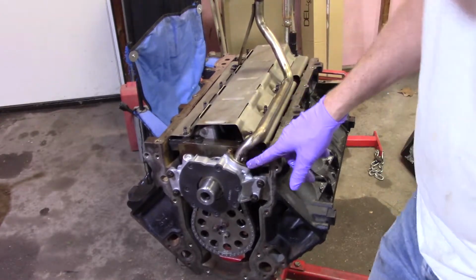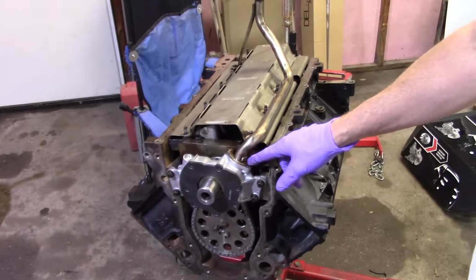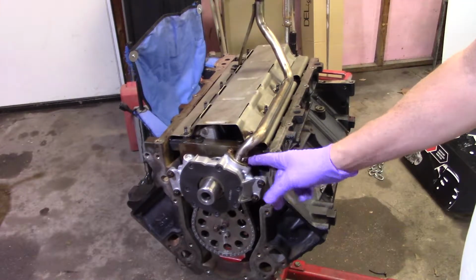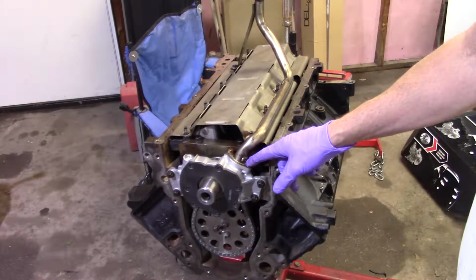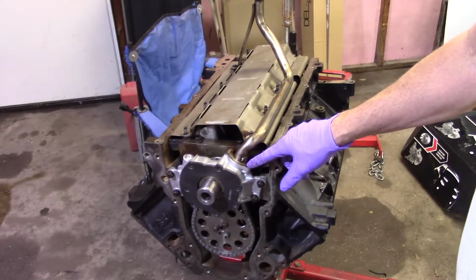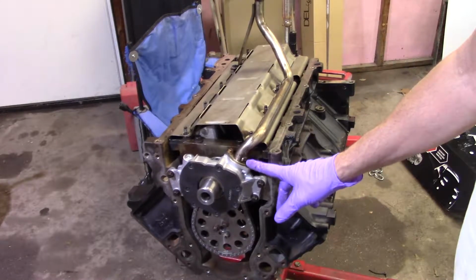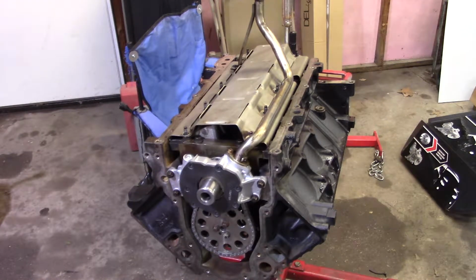So, okay, they do make a kit that will replace it, for if you cut it off, or if it's a whole different deal. And I've seen guys do that. They'll actually take an old one of these, if they had an extra motor or two, and they'll cut this, and then just kind of run the fork under this piece here that's tapped on, and then just put another bolt in. You grind this out just a bit, and then the bolt will fit there, and then it'll hold down. Another guy just notched this a little bit where that bolt would be, got a little bit longer bolt, and stuck a washer over top just to kind of grab this as it went down. I'm not going to do either one because I'm not really seeing it necessary to do that.